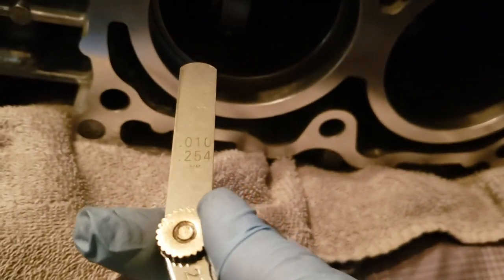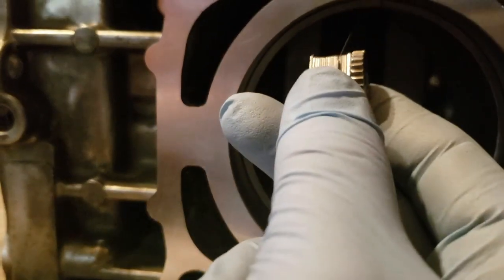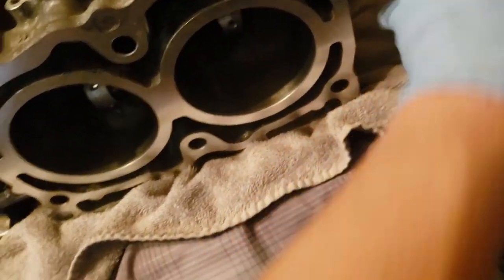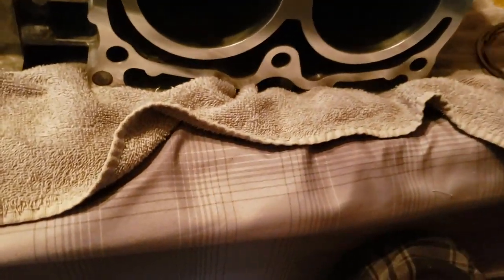Then we can go in and check our piston ring clearance — you can see the gap up there. That's pretty much all there is to checking the piston ring end gap. All these top rings and second rings are done. There are a lot of different ways to change the ring gap — this is probably not the most precise, but it worked. I just took some 100-grit sandpaper, clamped it between, and worked it back and forth. Then I went up to 320-grit to smooth any rough or pitted edges and now they look good.